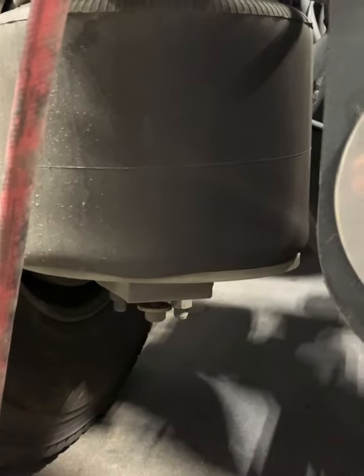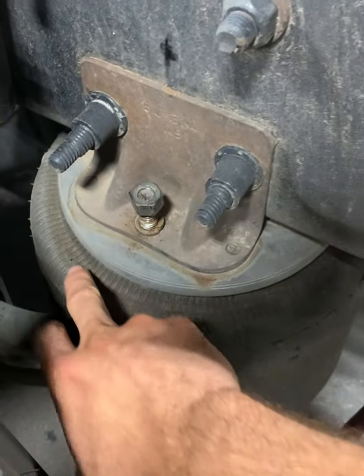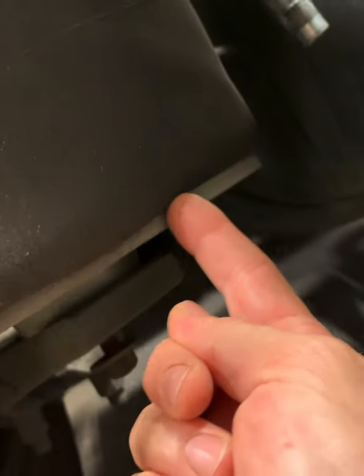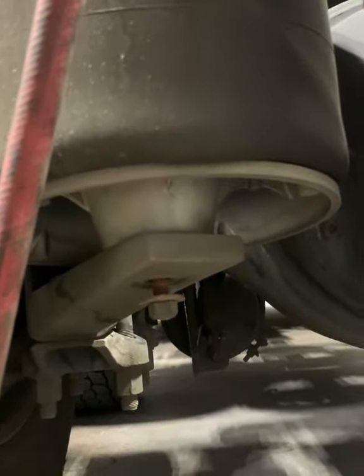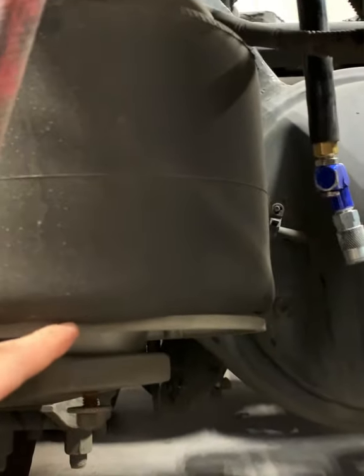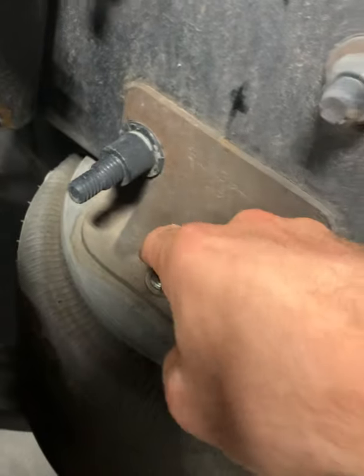So how do you replace these airbags? Well, I got answers. Most of the time you replace them because they get dry and crack around the top or along the bottom. You'll be able to tell once it's all inflated — get some soapy water, spray it down, and you can see them bubbling. Either way, all four are getting replaced. These are just two bolts, which take a three-quarter socket up top.